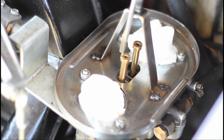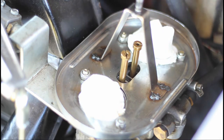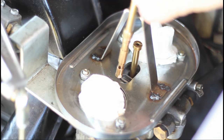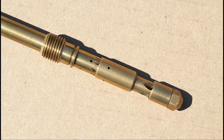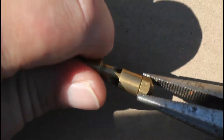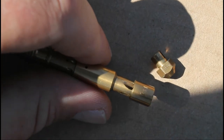The next step is simply taking a screwdriver and backing out the jet holder. Simply lift out the holder with the jets and air emulsion tube. Once you have them out you have to separate them very carefully. Take a needle nose pliers — or sometimes they're loose enough to do by hand — and remove the main jet from the end.